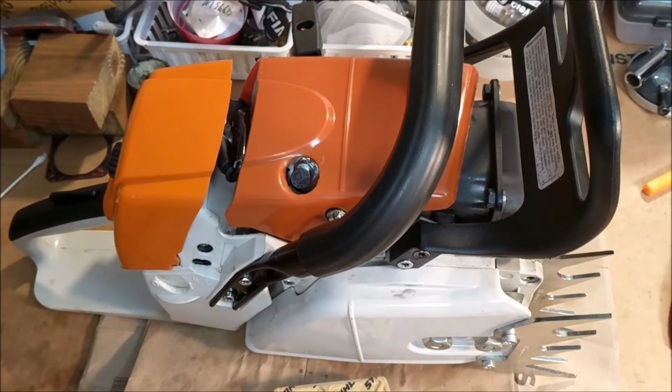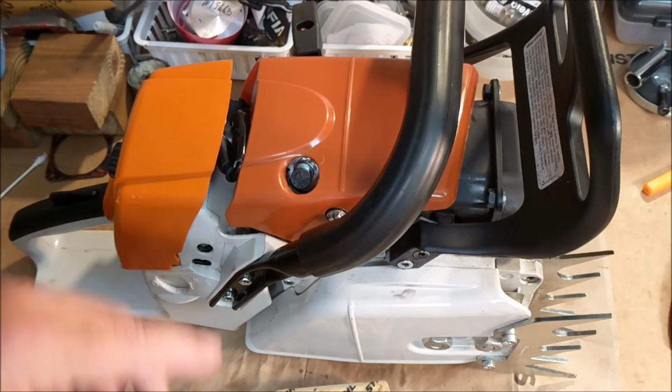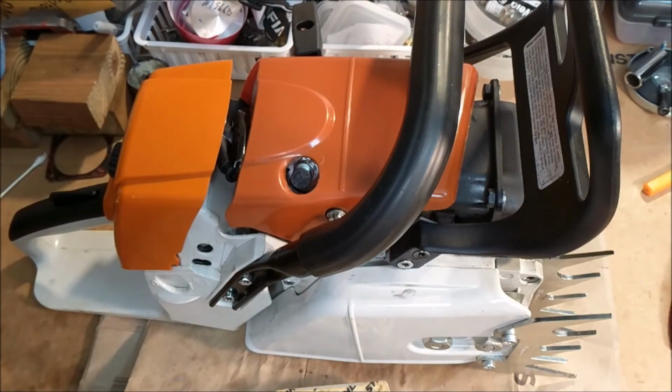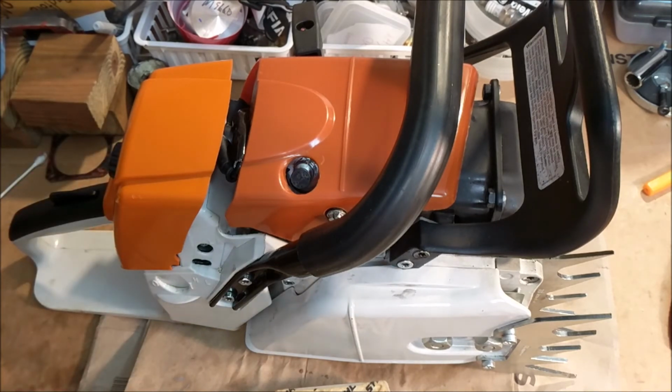I checked with a tester, and I used a chain draped over the saw, grounded on the ground, took the plug, laid the plug on the chain, and I'd pull this baby in the dark, and on all 3 I would get a pretty blue flame off those coils. So at no time was this caused by a coil problem or an ignition problem. So I just described the carburetor issue and how I solved that.